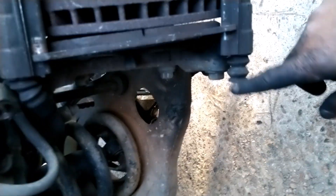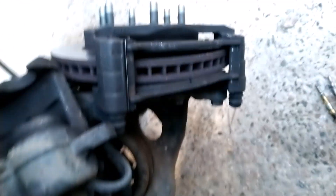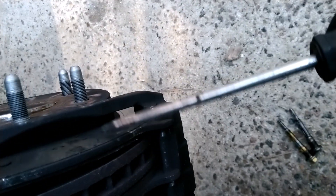Once you remove the caliper, one bolt goes here and one bolt goes here. Then you just hang the caliper up here — you can use a wire. This is the caliper; it holds the brake pads. Put it up here. Sometimes it can be hard to remove — it can be very tight and you have to fight with it a little bit — but eventually it will come out, and now these are the brake pads.